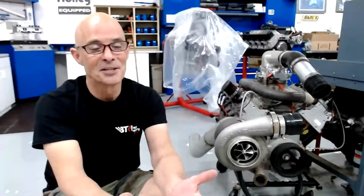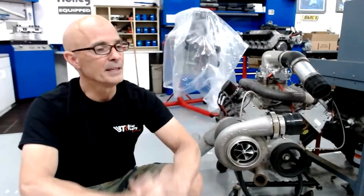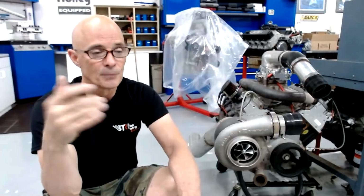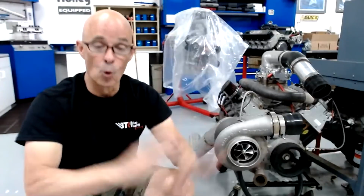I don't think that there is. I've never seen anybody do that. The way that I've seen people do that is the one way that we can increase the power output dramatically at the same boost level is by cooling the charge air. So if we go from water in our intercooler or air to ice water, we can make more horsepower per pound of boost, more than the formula suggests, by having cold air.